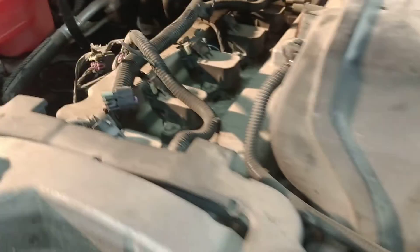The other issue is the intake manifold is behind the alternator. Do you see the alternator back in here? There's a bolt — the alternator is in front of it — so you have to pull the alternator or pull it loose. You've got to pull the battery so that you can pull the intake manifold so that you can pull the valve cover. This is how jobs that should take 45 minutes become five hours.